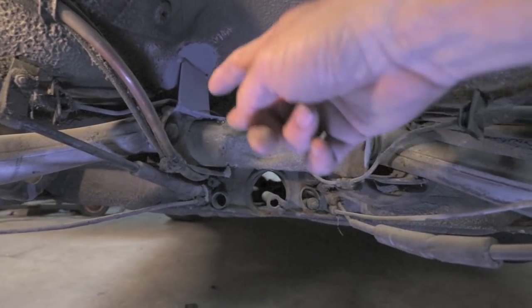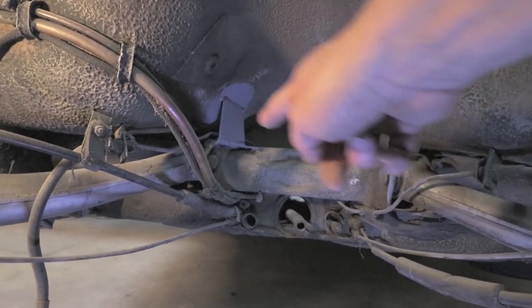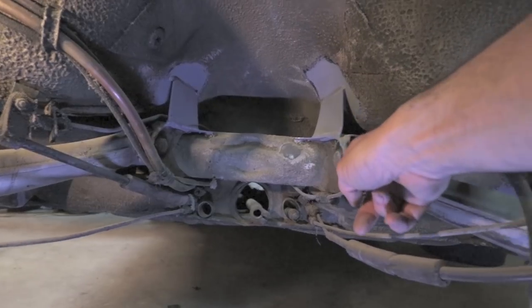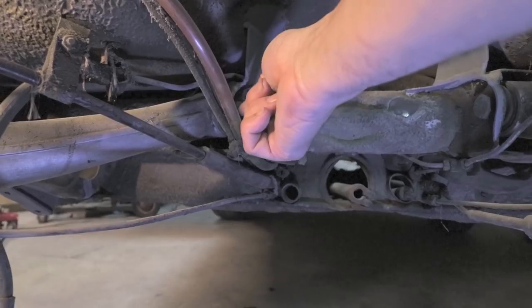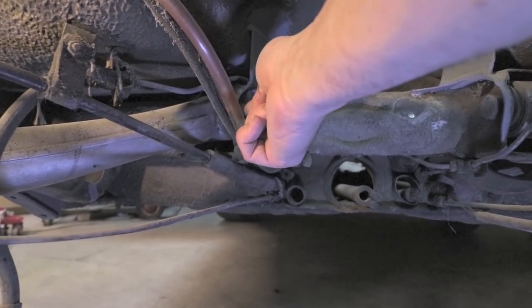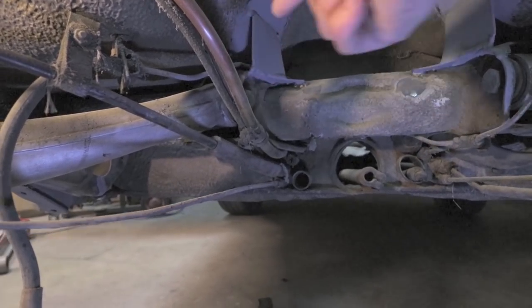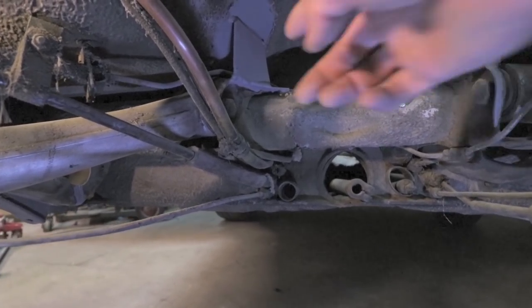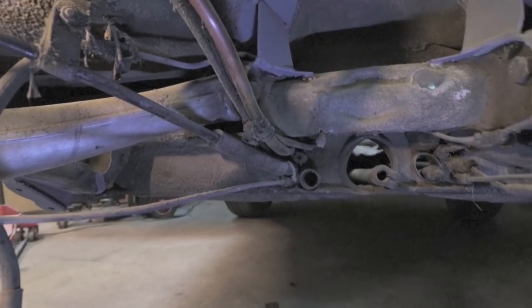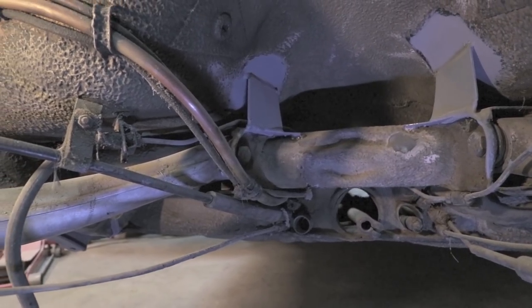Let's do it. Here we are under the car and this is the area I'm talking about. These trailing arms left and right attach to the torsion tube and they're attached right here with these beefy brackets. I'm going to take these locations and make them adjustable. I'm going to keep this factory hole but add probably two more above it, which is going to encroach on the seat pan a little bit. It's actually going to protrude through the seat pan and then get boxed in and attached back to the torsion tube. That really creates a stronger section and also gives something inside for the roll cage to attach to. So it's going to be a combination of adjustability and increased stiffness.